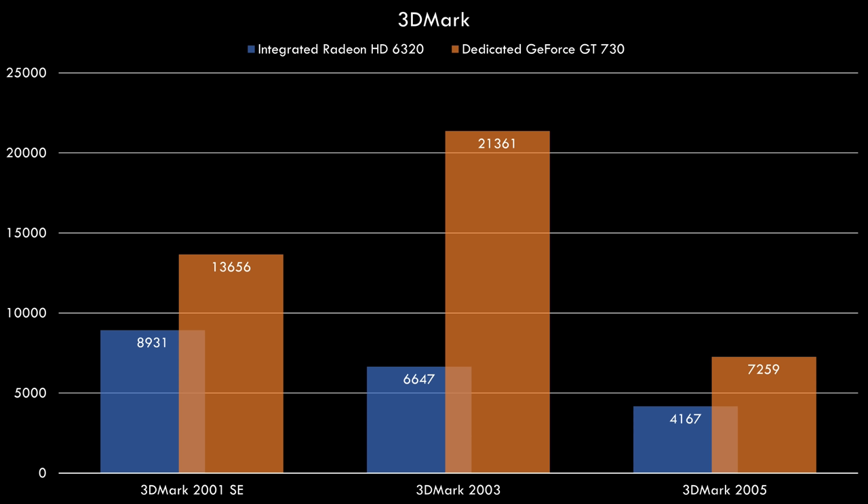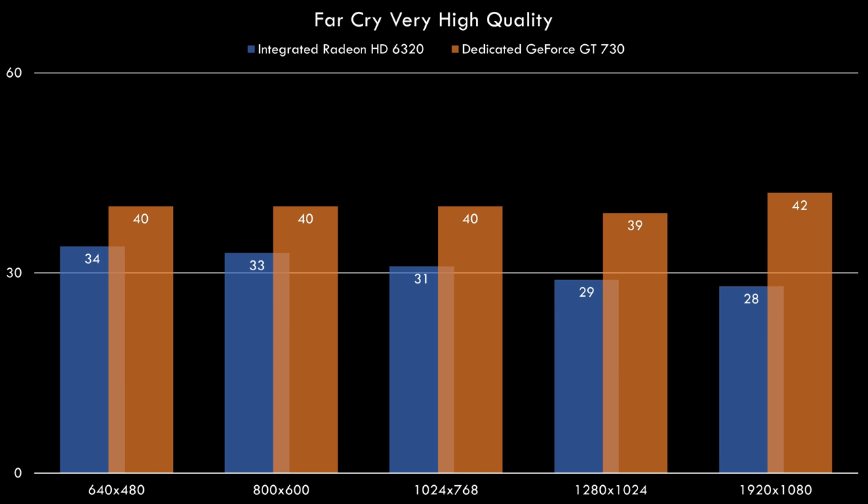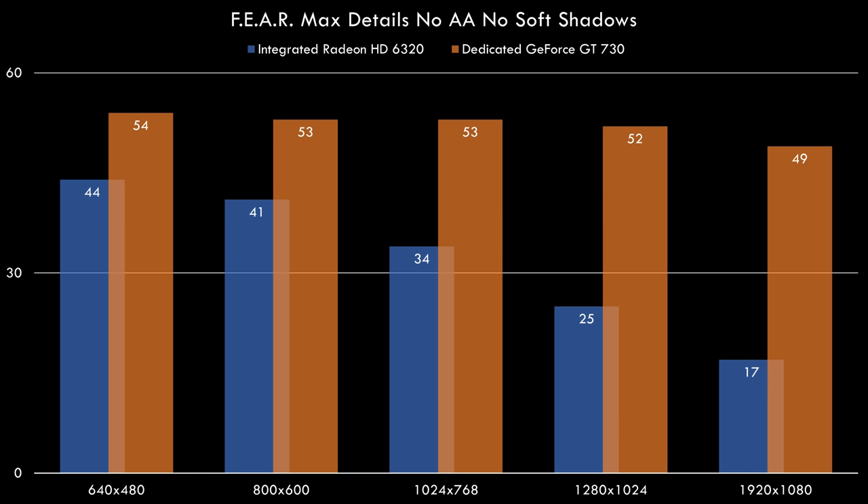As we see in the benchmarks, the 4x wiring is actually not an issue. We're back with some benchmarks — the orange results show the dedicated GT730 and we're getting a nice upgrade. In 2001SE and 2005 we're getting quite a significant boost, but look at 2003 — that benchmark is just the right combination of processor and GPU requirements for this machine to really shine. In Quake 3 the Radeon was actually faster at lower resolutions, but the Geforce is very consistent around 160 FPS and doesn't lose performance as we crank up the resolution. In Far Cry we're getting around 40 FPS with the Geforce, so the processor is holding this game back a little bit. Doom 3 runs well with a Geforce — we're getting basically 60 FPS across all resolutions. And in Fear we also see a nice boost around 50 FPS across all resolutions, and unlike the Radeon, even at high resolution we don't get a drop in FPS.